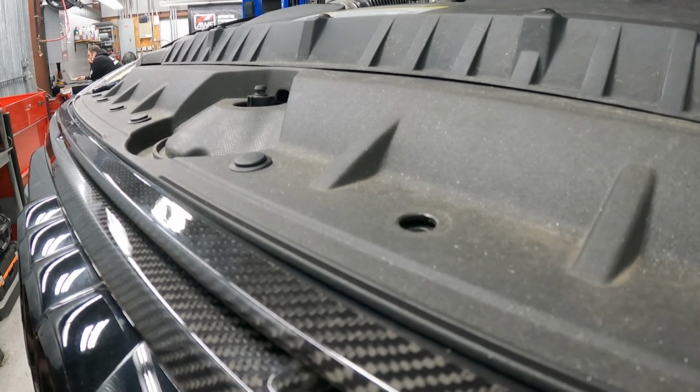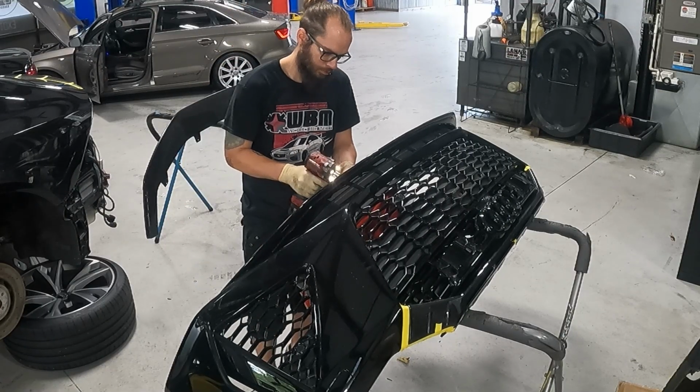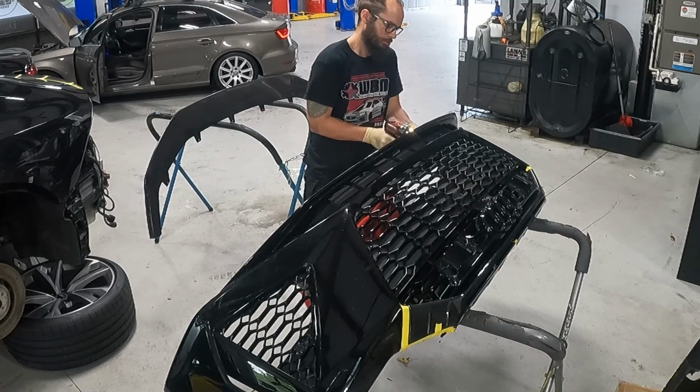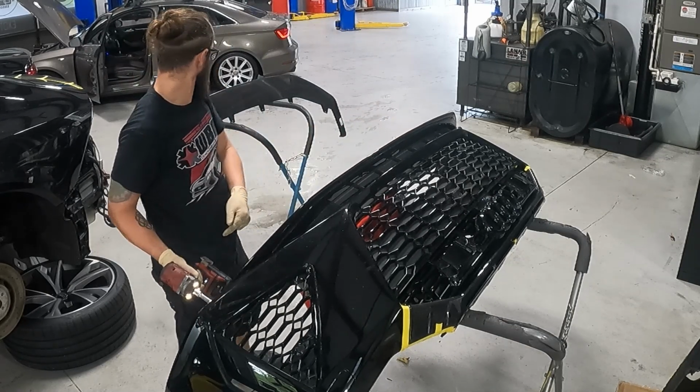Taking the car apart was fairly easy, as it was a 2021 with only 10,000 miles on it. But the front bumper had the most modifications with the least amount of cutting. It was mostly just drilling for the hardware, but every single piece of the body kit got fused to the car using panel bonding adhesive.